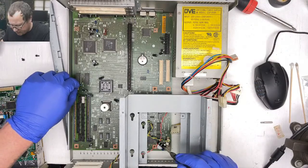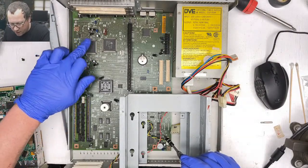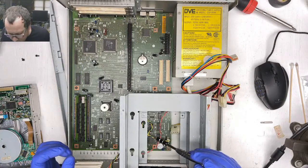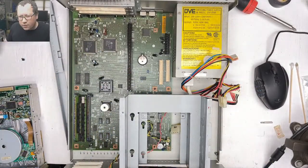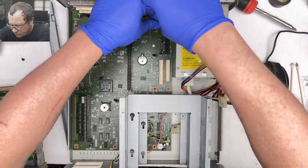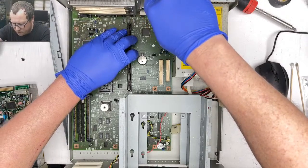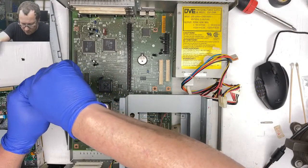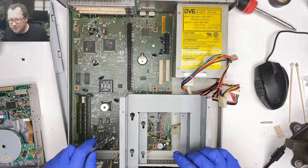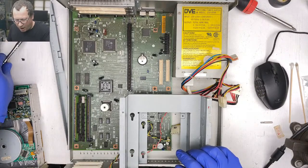It's also interesting, you can see here there's RAM, there's RAM. This is most likely the RAM for the video card, which is a Cirrus Logic 5422, which is actually kind of a nice ISA. I don't know if that one was also VLB or not. I know it was definitely an ISA version. Kind of a nice graphics chip, for those days, obviously. But for someone to go in and find a motherboard with a riser that would fit into this case, that's kind of shocking.